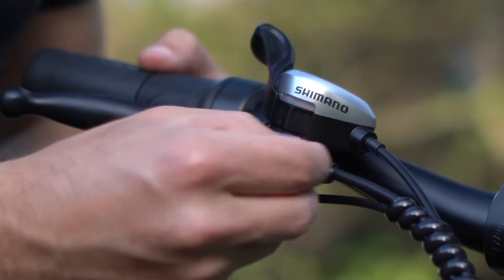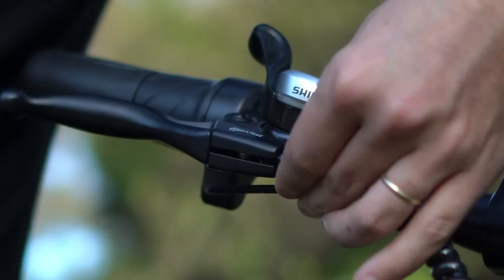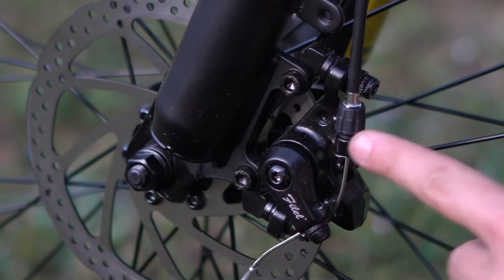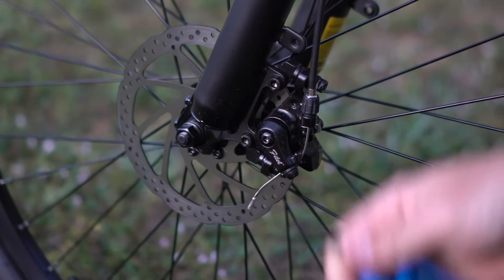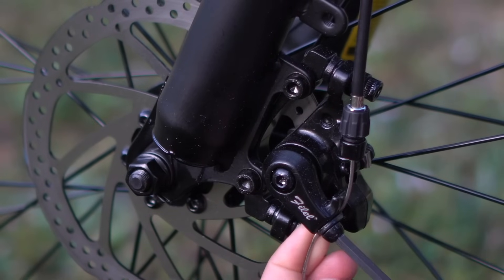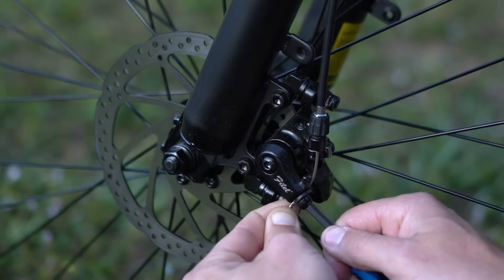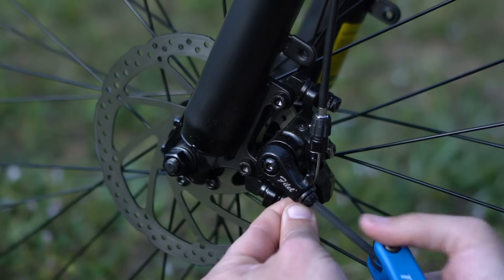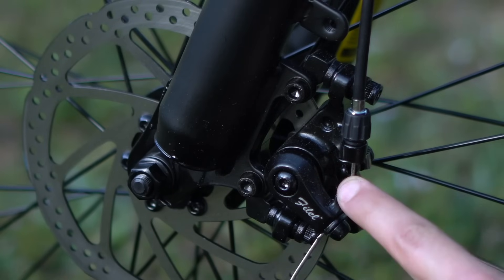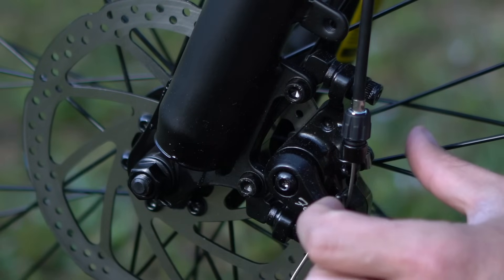When your barrel is all the way out and you don't have any room left, you're going to want to bring it back in and make a macro adjustment down at the caliper. You have either a micro adjuster there or you can make a macro adjustment. Take a five millimeter Allen and just open up this bolt. I like to keep my fingers on the backside to make sure the cable doesn't slip through because it is under spring tension. Now that it's loose, just slide the cable through a little bit more — usually just two, three, four millimeters — then retighten that bolt. That pulls more cable through, makes up for cable stretch over several months of braking, and resets your brake calipers so they're closer to the rotor.